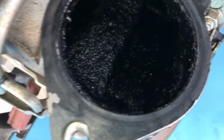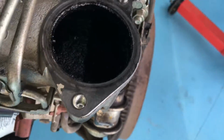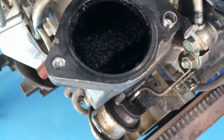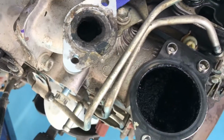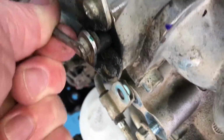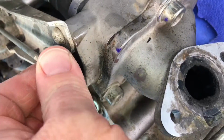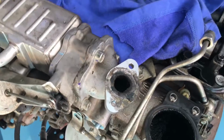To be clear like that, that's the oil washing it out from the EGR, but the EGR's not flowing. This is a non-flowing, caked up situation that'll all need cleaning out anyway, but then again, you probably get away with it because of the remapping. Does this even... yeah, that's seized as well, so that shaft that's meant to move, right? Oh yeah, no, it's moving a little bit now. Okay, no, it's alright, it's not seized, it's all good. I was wrong again.